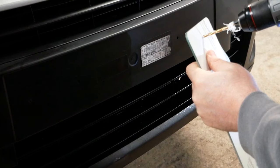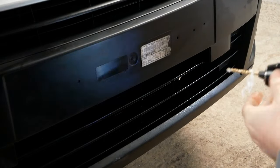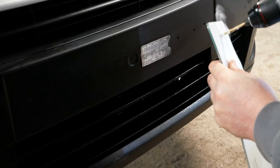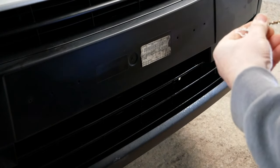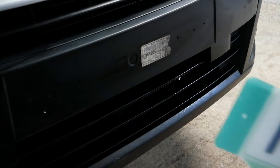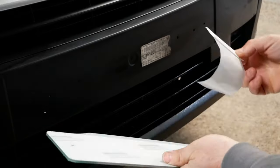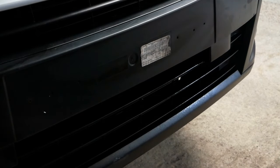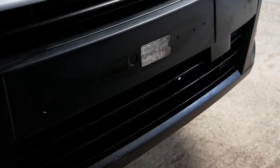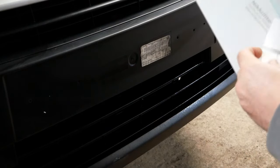Always mark on the back and drill from the back. Use a 4.5 or 5mm drill bit — that size ideally. After drilling, put your plastic waste in the bin — don't let that go into the water table. At this point we could just screw it straight on, but I always add a bit of sticky pad on the back as well for extra security. In this case I'm just going to cut a pad in half and put it next to each screw hole.